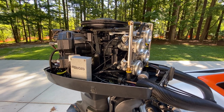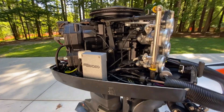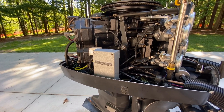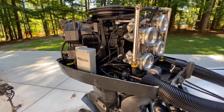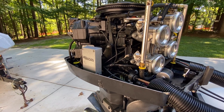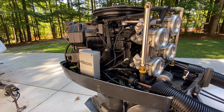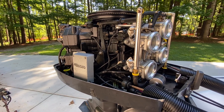Not to mention drivability, starting, idling, and better fuel economy. The ECU we use on these is the same one we use on Mercury outboard motors — it's an open-loop system, meaning there's no O2 sensor and no feedback. You can't really use an O2 sensor on these motors successfully because of the oil mixed in — it'll foul them up. So it uses a MAP sensor.